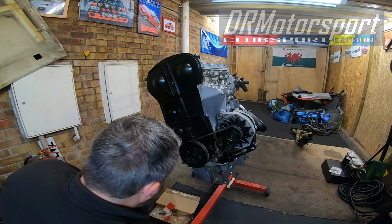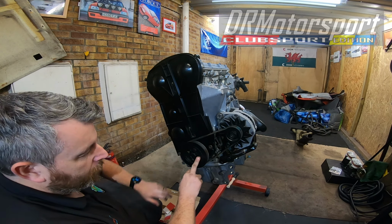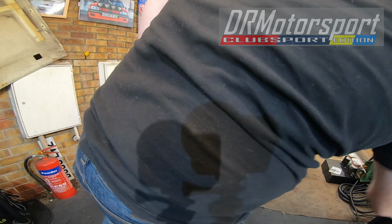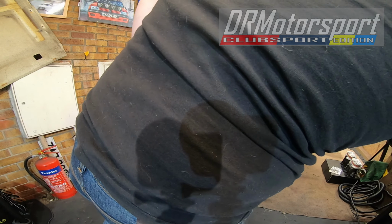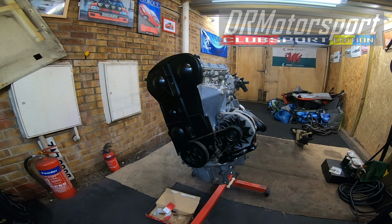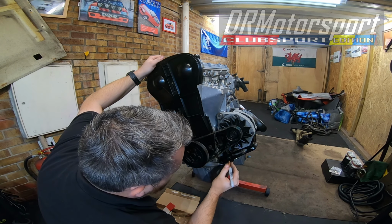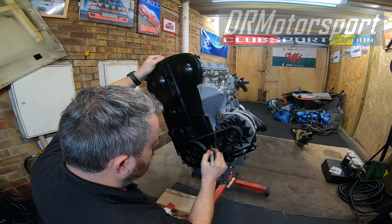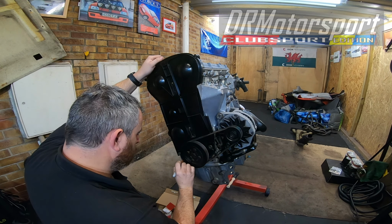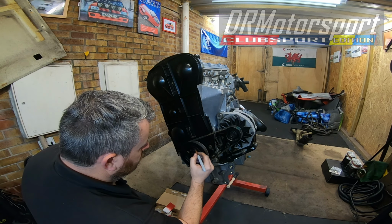Right, a little bit of touching up to do, nothing major. But what I tend to do as I'm going along, especially if I'm building the engine, I always leave a mark in there. Let's have a look. Where has it gone? There we go. Basically everything that's been tightened up. I have done that one. So that's been done, so I'll put a little mark on them and that's done. I'll paint that one. Basically, it's a quick reference to say that I've done them.